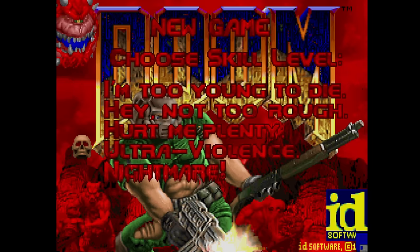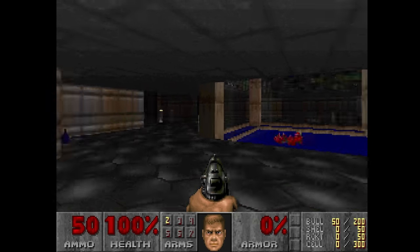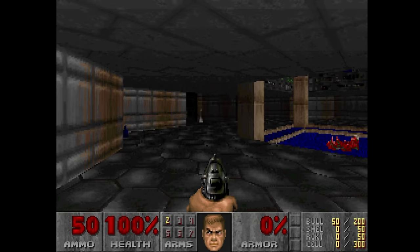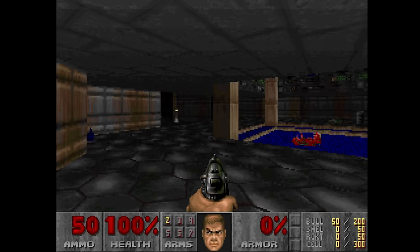And Doom. It's not exactly stellar, innit? The fix was quite simple. I just forgot to change the MPU port on the Sound Blaster from the default 330 to something else. And after that...